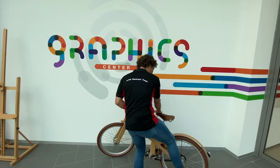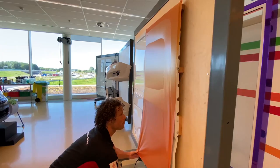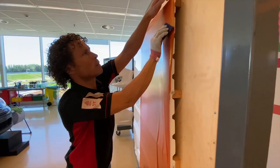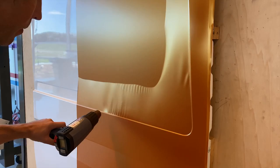I am going to show you a few simple and solid techniques. There are other methods that you can use, however, what I will demonstrate will put you on the right track for sure. During the installation you will often introduce tension into the material by squeezing or simply stretching the film. This tension can always be removed by using heat. Important here is that you evenly warm up the film to a temperature of 40 to maximum 50 degrees Celsius and keep the heat gun in motion.